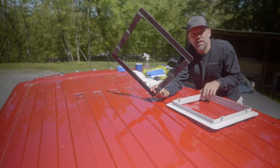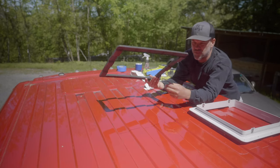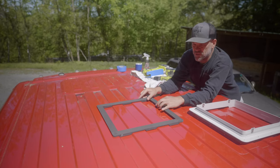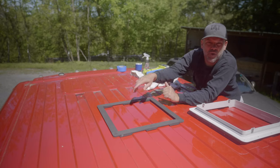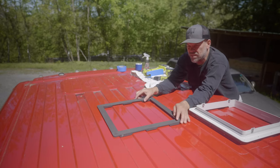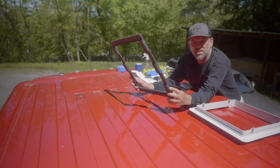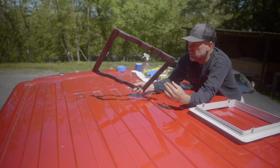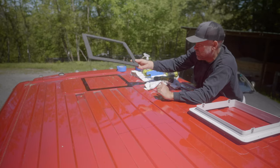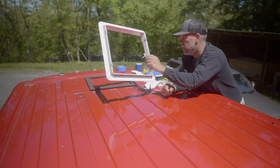Got this off of eBay. This is for the Promaster roof vent adapter. Pretty neat. Just throw this on here like this. Mark it out. Obviously measure, make sure you're not going to hit the cross members in the ceiling. But it's made out of PVC. It's CNC'd. So it's pretty neat. Like I said, go on eBay. I'll put a link in the description. And then the flange, you got to screw down.